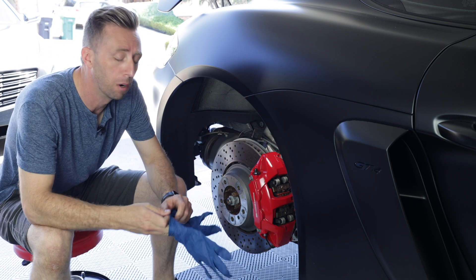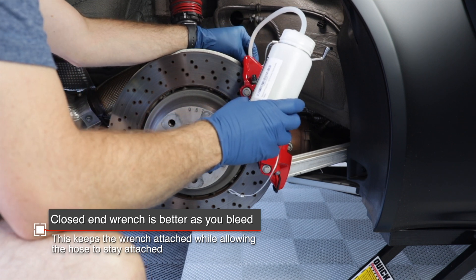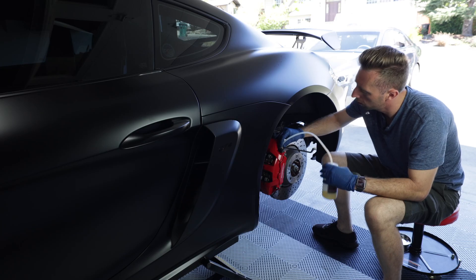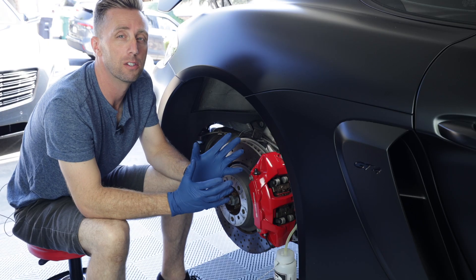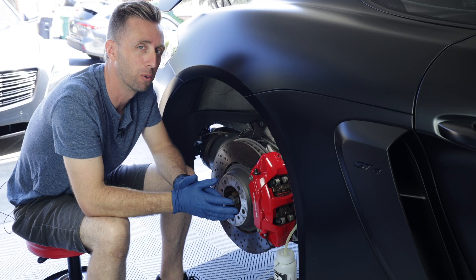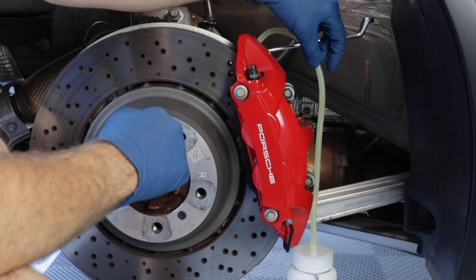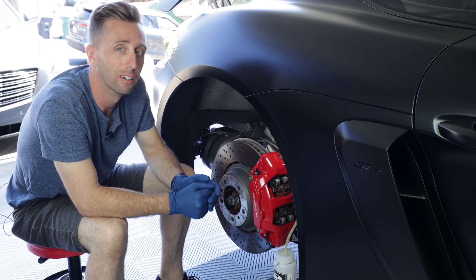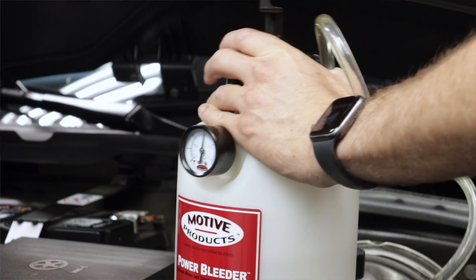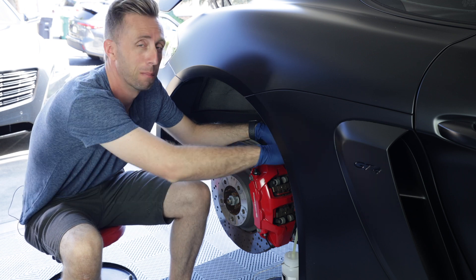I almost forgot a very important safety tip — wear rubber gloves to keep that brake fluid off your skin. Put your wrench over the bleeder screw and attach the hose. We'll bleed the inner bleeder first, then the outer, then move closer to the master cylinder: driver rear, passenger front, then driver front. Because these brake lines are the longest, bleed at least half to almost a quart of fluid to ensure you get all the old fluid out of the reservoir. One indication to look for is that old fluid is darker than new fluid, so it should start getting lighter in color. Always make sure your power brake bleeder is pumped up to proper pressure levels. Don't over-tighten the bleeder — you could break it off — but make sure it's not dripping.